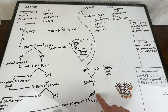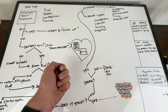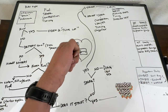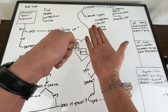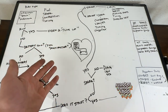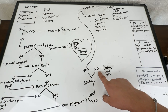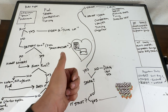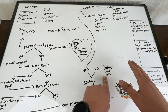Let's say you do not have spark. You pull the cap off the spark plug, take another spark plug, put it in there, hold it up against the motor, crank it over, and you should see a nice blue spark. Or remove the spark plug from your bike, stick it in the boot, take the metal of the spark plug and touch it against the motor case - you should see a nice bright blue spark. If it's weak or dim, it should still run, but if it's really weak and really dim, you need to diagnose the ignition system. Make sure your kill switch is on, your key is on, everything's in the run position.